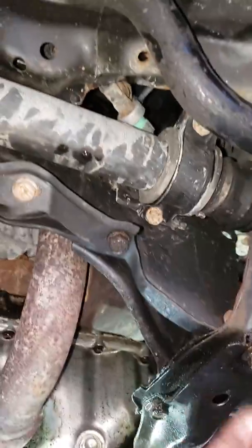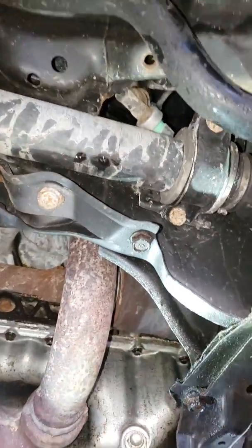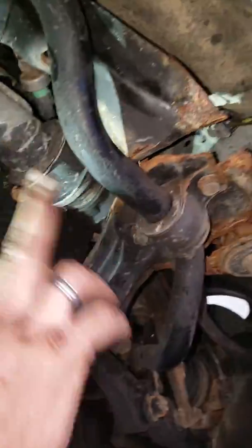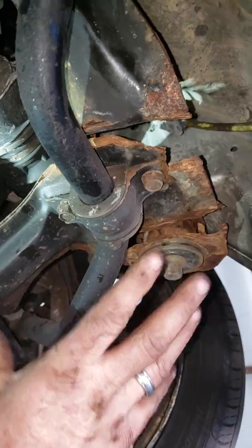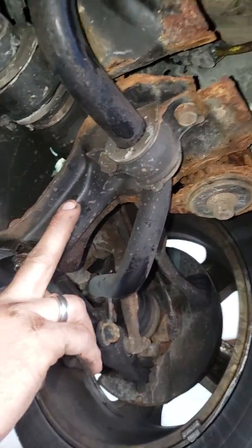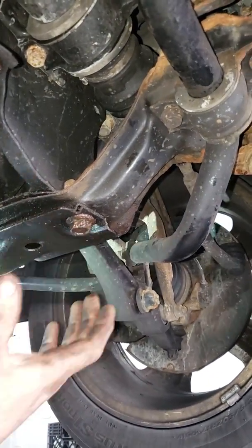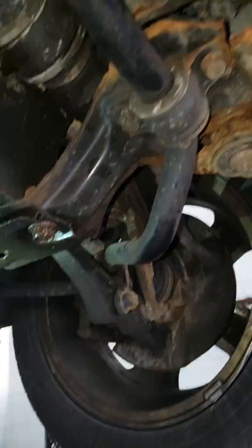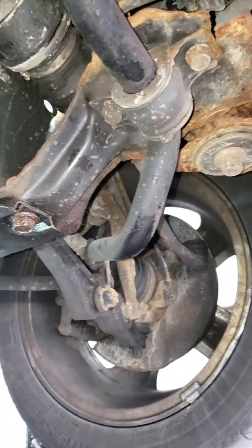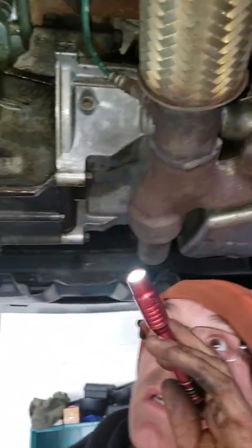Usually this is all one piece. Can it be welded? No, no. You would never get that exactly where it's supposed to be with a weld. You're going to have to replace this piece. Looking at it, it looks like this subframe is maybe a two-piece — a front portion and a rear portion. That might save you some money. There's hope. But still it has to be all taken apart and replaced.